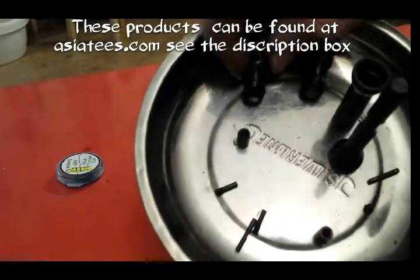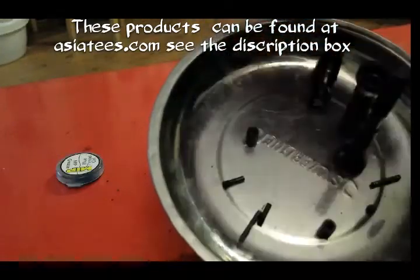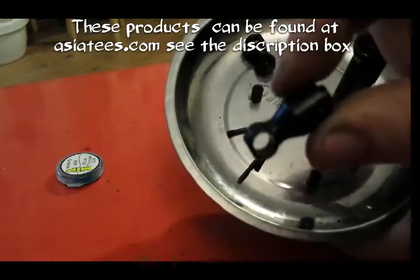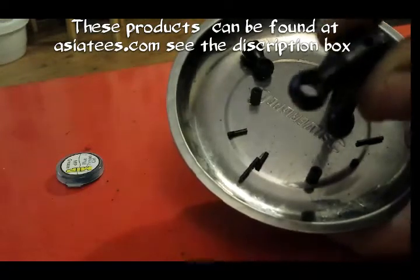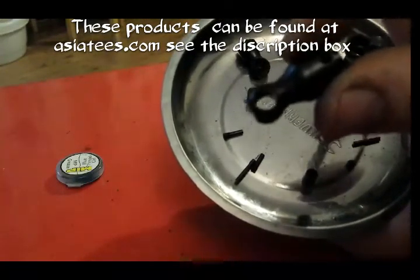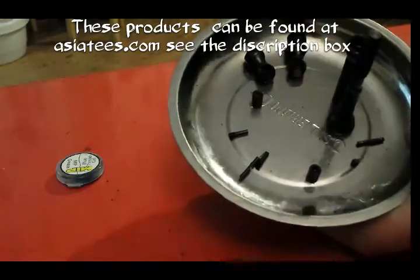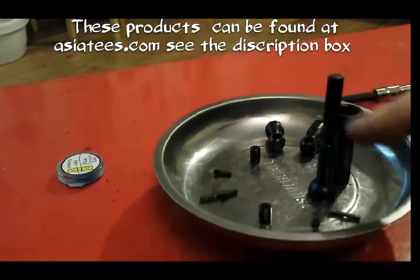So you get 4 of these, which are the universal joints. So 4 of them, one of which is longer than the rest if you're running a honcho. They do 2 kits. Now in the standard kit there's 4 of them the same length, and then the honcho length one, which is 12.3 inch wheelbase, has a slightly longer rear one. It goes on the axle. That's just basically, it keeps you enough of the spline in the shaft.